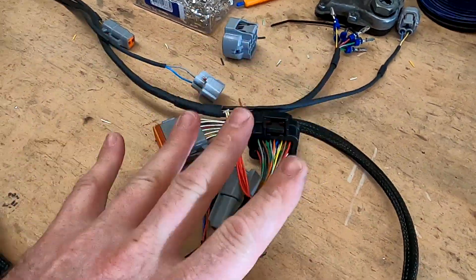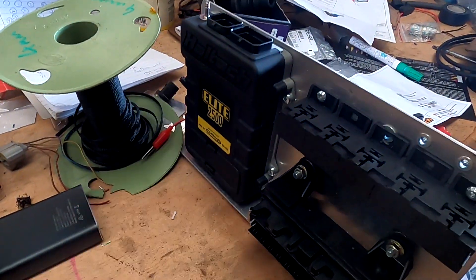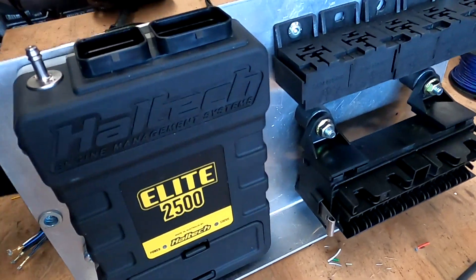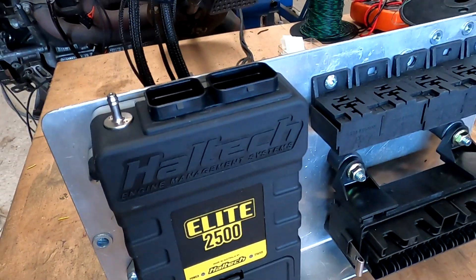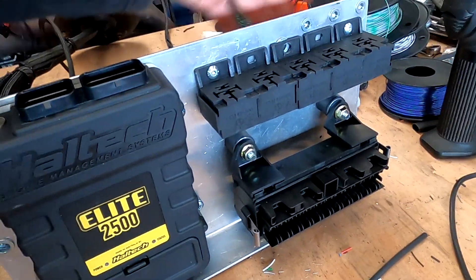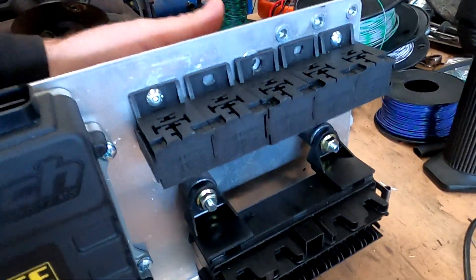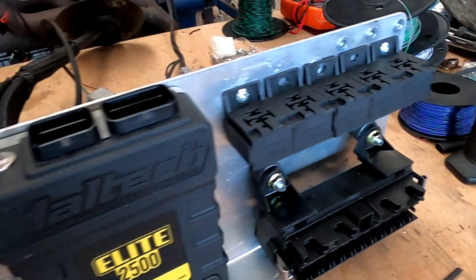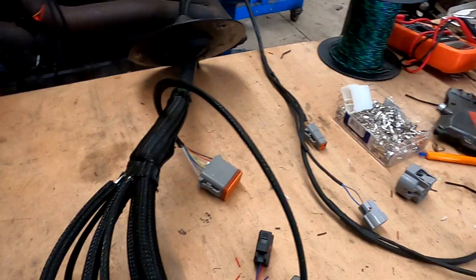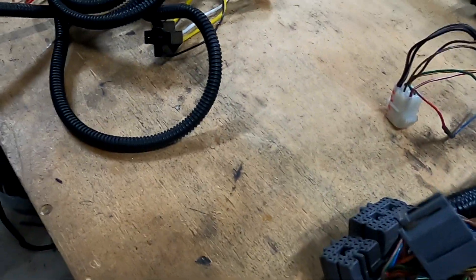This is pretty much complete as far as I can go until I get relays and fuses all happening inside the cabin. This is going to sit facing outwards — the ECU's plugs are going to pop in over the top like that. I've got to work out where I'm running the power supply out of the relays and fuses, whether I go straight through the back or around the end. I'm going to lift this loom off and actually do a test fit. Just a little mental note — this is the wiring that came out of the Zephyr, a bit wrapped up here.